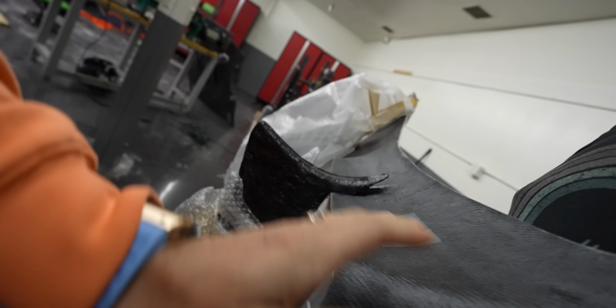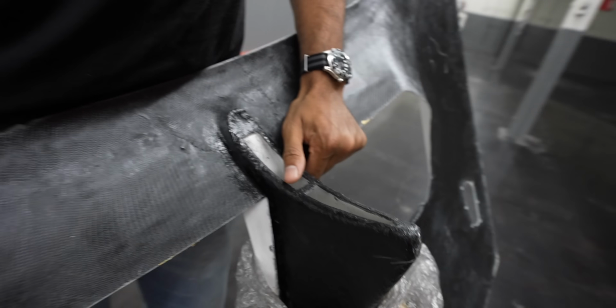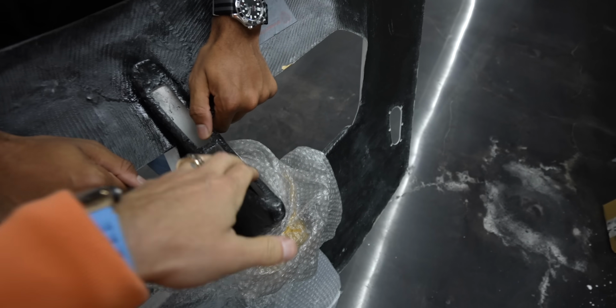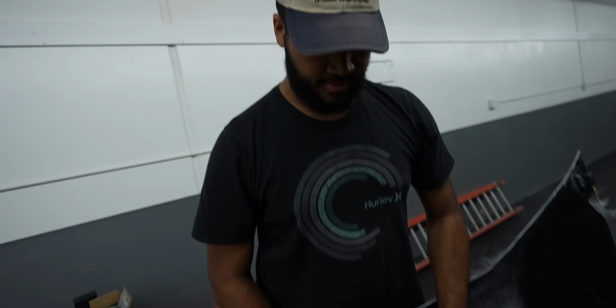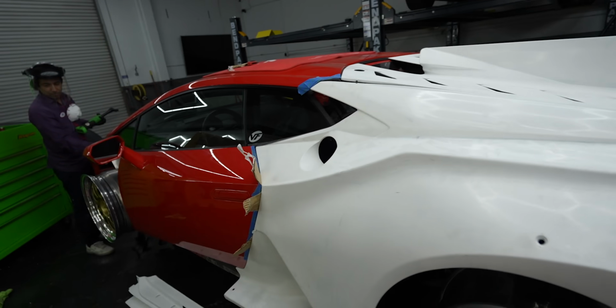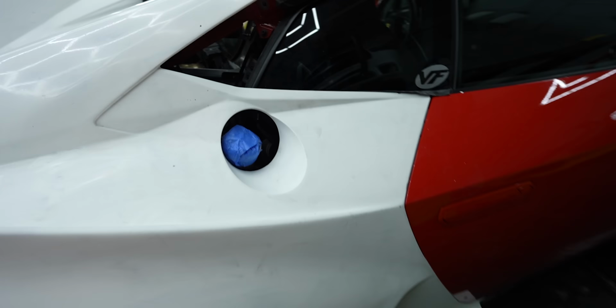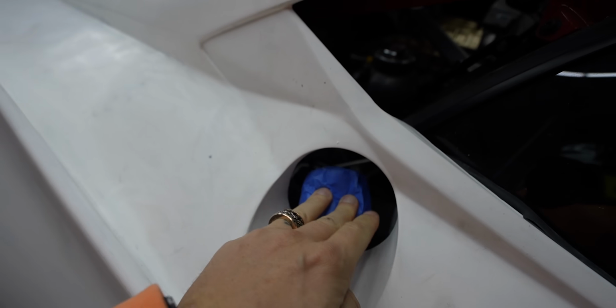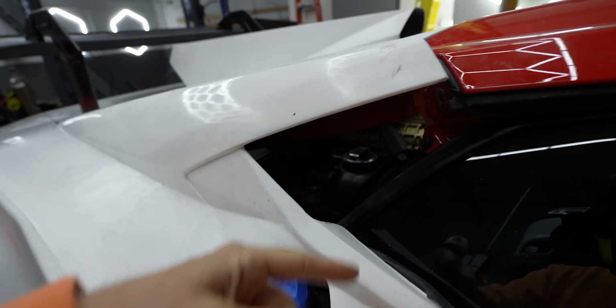Okay, look. The hood's not flat underneath. We're not going to cut any of this down, so we have to actually remove the compressor because it gets hit by this. It's obstructing it from going on. So there are so many pieces, as I was trying to explain, where the underside of all these panels conflict with certain pieces of the street car. So there are so many things that need to be moved and redone, just like on the opposite side. John went and removed a bar that actually holds the fuel filler cap in a certain position. So now it has some flexibility to move around. There were other pieces under here he had to remove.